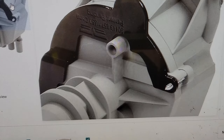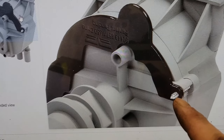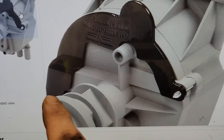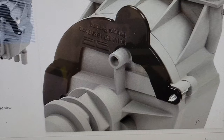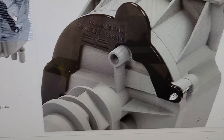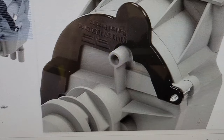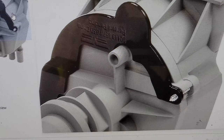This is basically what it looks like from underneath. You can see this ear here is broken right off, but the cap screw comes through, anchors here, anchors there, and also on the back screw. If you work on Vortec engines, I'd definitely keep one of these in your toolbox — whether it's your own car or a customer's — because it never fails: you think it's just a cap and rotor, you'll knock it out, and you're scrambling when a customer comes in and parts places are closed. Pull this out, save the customer a lot of money, save yourself a lot of hassle.